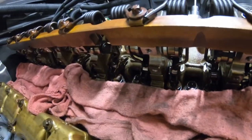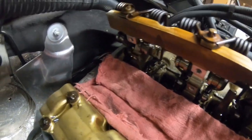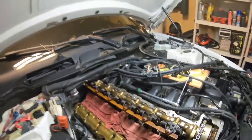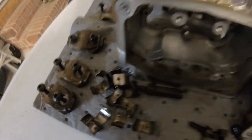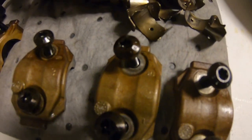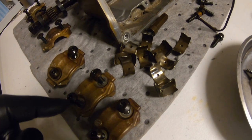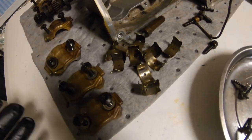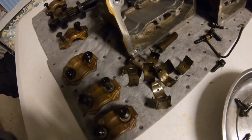I have all of the bearing shells out now. I'm going to pull all of these old ones out - half of them will be inside the cap, and the other half will be inside the engine. You have to pull the ones out of the engine because you're not reusing those. All of these caps are numbered: one, two, three, four, five, six. One is at the front of the motor, six is at the back. You don't have to worry too much about keeping them in order when you lay them down, because they're numbered - just put them back in number order.